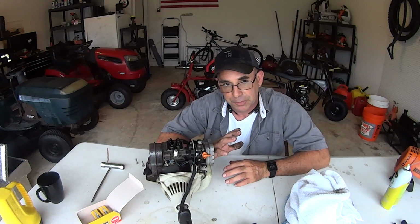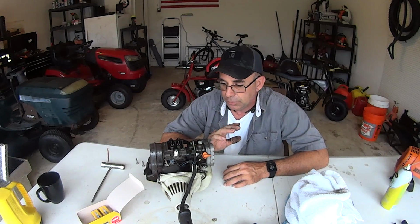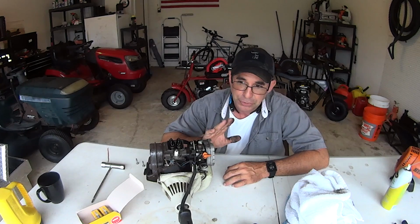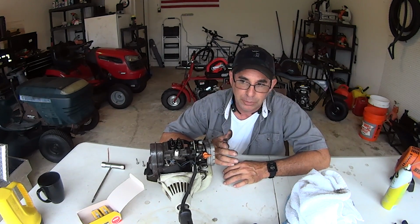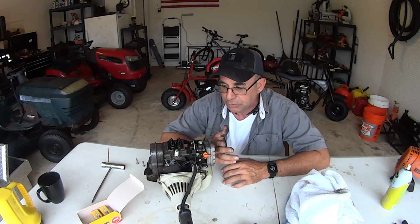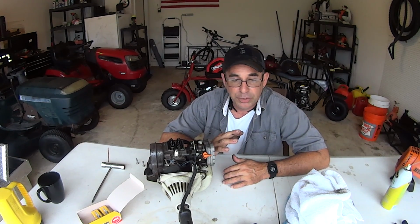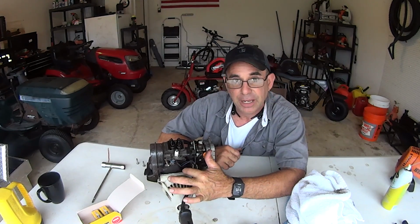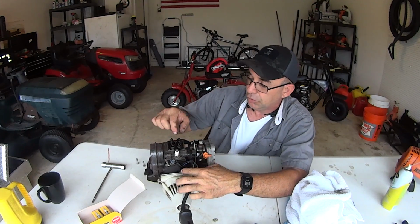I'm sorry if that was a little bit painful, but the purpose is, this is what you're going to find. I'm showing you exactly what you're going to find when you go home, to your shop or garage or your lawn trailer, and you want to do this. You're going to need to know what is top dead center and what is not, and what to look for, and that's what I'm showing you. So that arrow on the flywheel that I was spinning, when it's straight up and down, you're going to have play here.